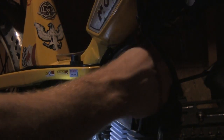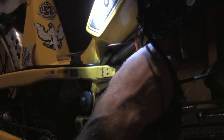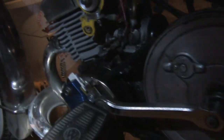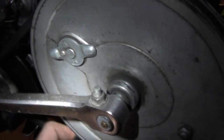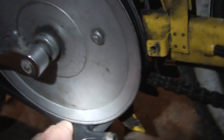My next step is to get this timing tool inside the spark plug hole. There's usually a bit of a clearance issue with the frame. What I usually do to take care of that is find any old something to slip in between that belt and the big pulley. Your old pull start handle works great. That's pretty much all I need — just something to take up an inch or so and pull that motor into the variated position.